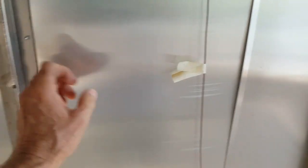I had a large rolling toolbox mounted here, anchored to the wall, and these two supports — these two beams — buckled. I'm having to straighten them back out. I didn't even know they were bent until we took off the interior. Obviously it was too much pressure, and you've got to keep that in mind when hanging cabinets and shelves on these walls — those are not one-by-one box tubing.